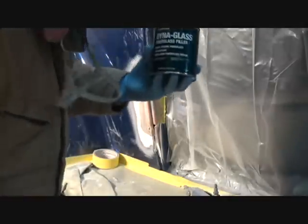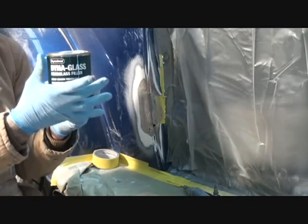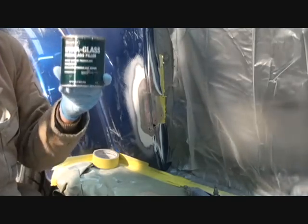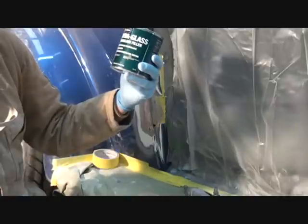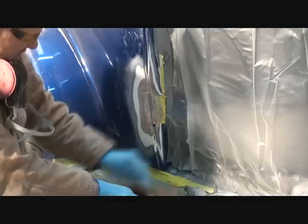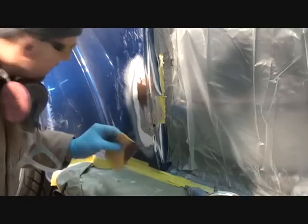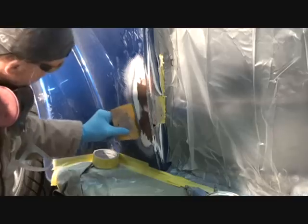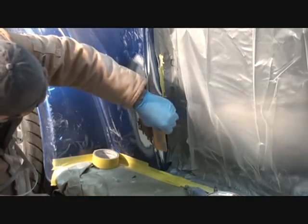This is a very good overall fiberglass, metal, SMC — which is plastic repair type of filler. So I take my Dynaglass — I'm left-handed, so if my hand gets in the way, you know, that's too bad. All I'm doing is filling in the low spots with this. I'm not going over the whole thing — I also need to fill in the holes that did not get filled in with fiberglass.